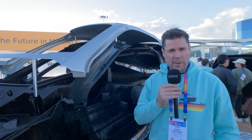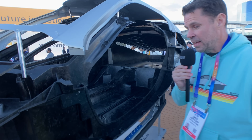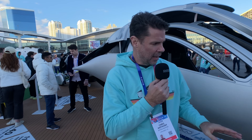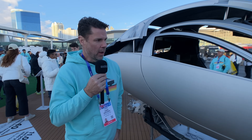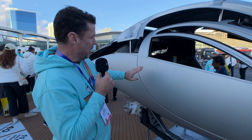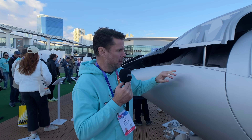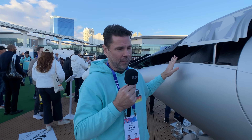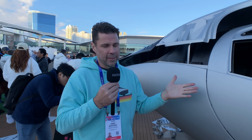The first probably 5,000 vehicles we build will all be 400-mile range vehicles. Let's say if you had an impact on one of the carbon parts, how would repairability work? Would you separate these? Well, all of the exterior-facing parts, like on the other side of the vehicle, are fiberglass. So if you get a door ding or damage this part, that's repaired just like you would repair a boat. It's just fiberglass, so you can actually replace that. If you get inside to the more structural stuff, then it's more difficult to repair. If you crumple a lot of the carbon fiber, you're going to replace that carbon fiber piece — you can cut out sections and replace sections, but you'd probably just end up with a whole new body because a whole new body for this is relatively inexpensive.